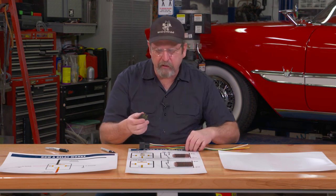If you have a relay mounted close to your electric radiator fan, then when you flip that little switch inside — which is just a low voltage switch — you can have a short distance from your battery or from a fuse block out in your engine compartment to the electric fan. Keeping that circuit real short will increase the amount of voltage and amperage available for the actual device itself.